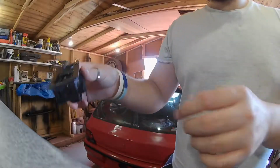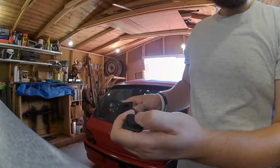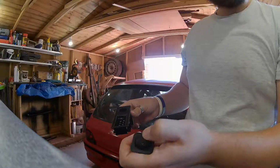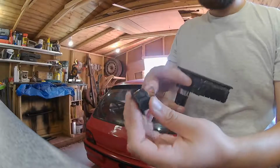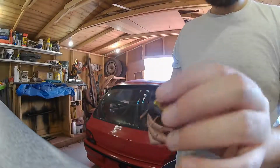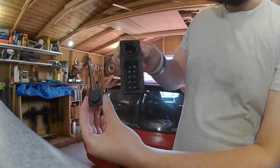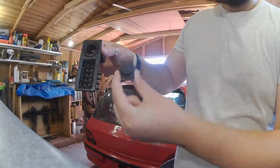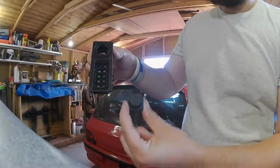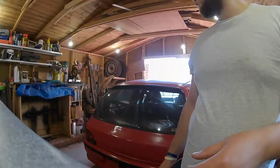And I've just got to cut the panels, and after that we've got some 25 amp switches. Got these off eBay, simple, just click and plug. Red LED to tell you the power's on, square face with a round hole, nice and easy. Just use a hole saw, plop them in, and they just hold in. Just wire them in to the fuses, and hopefully that'll be sitting in the middle, and then there'll be 4 switches going to random things basically. So that should be good, and that's hopefully one of the other things I want to get done today.